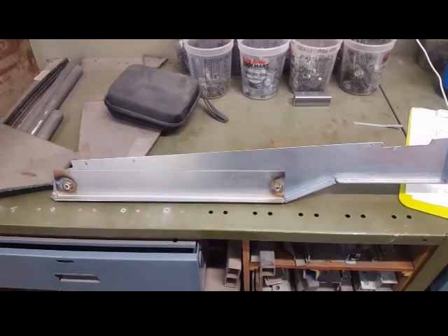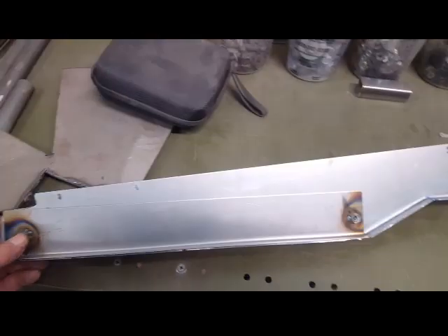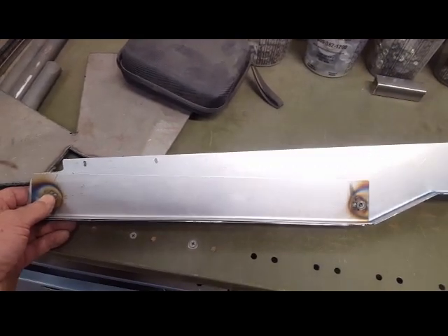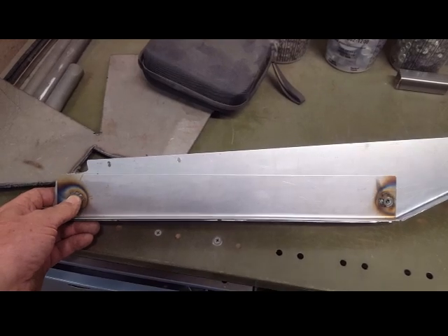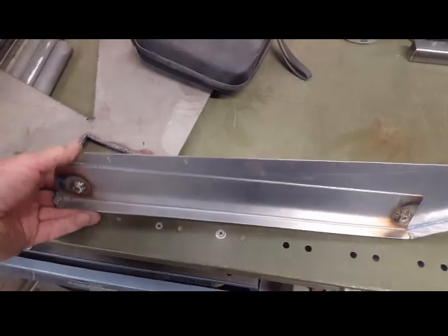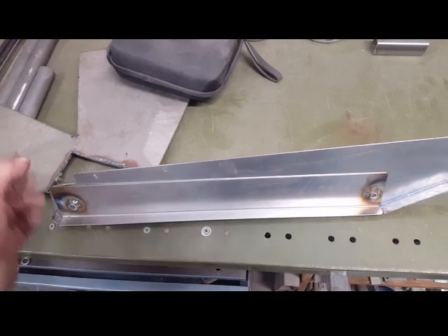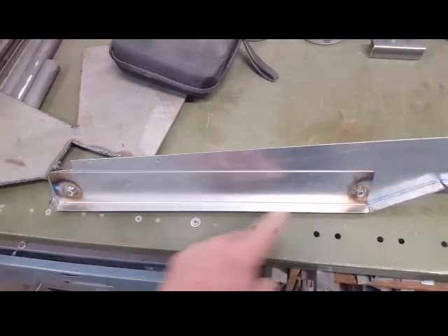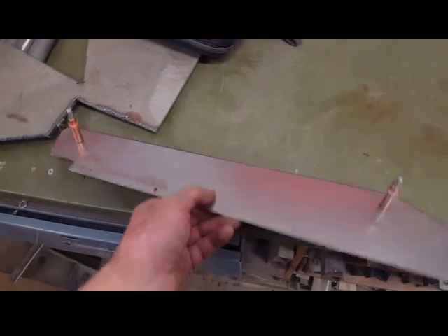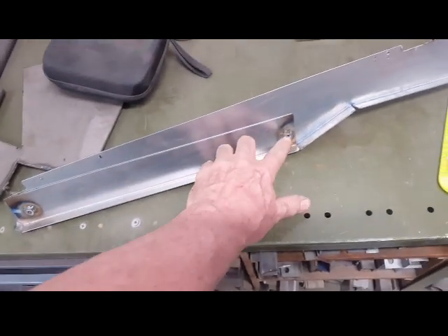With this tray out of the car I'd already located where I wanted the glass to end up and where to start adjusting it up into place. From the very bottom, where everything was located, I drilled pilot holes through this piece, marked it, and drilled through so I could mark the locations on the mating piece. I've got both of them held in place now with Clecos, with just that eighth-inch pilot hole through the center.